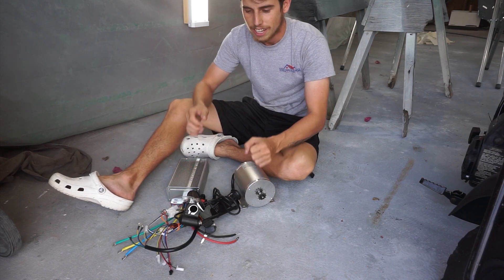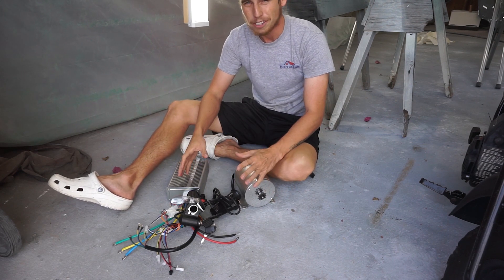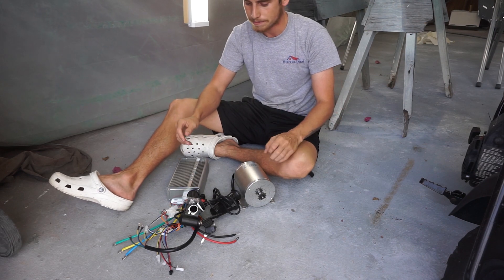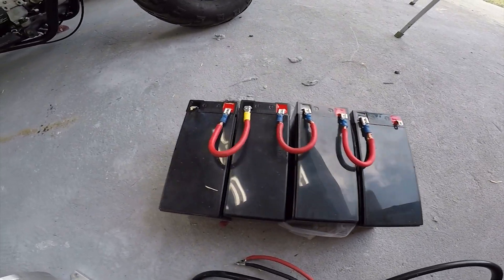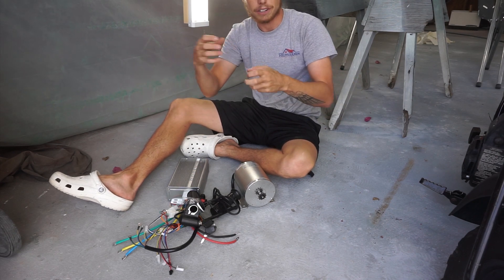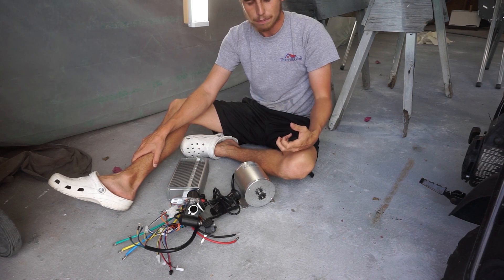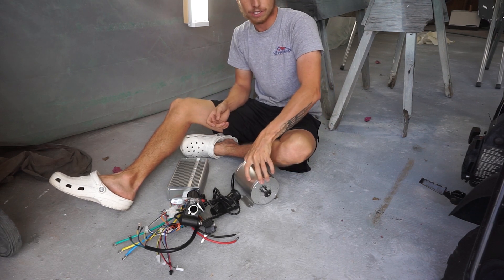As for the batteries, everyone's going to be telling me to get lithium-ion and all this kind of stuff. I thought about doing that, but the packs are so big I don't think I'll have the room for it, and I want it to look all uniform. So I'm just going to go with straight 12-volt lead batteries — the rechargeable kind. That way I can put them in different areas of the bike, maybe balance it more towards the front and have a couple in the back. It hooks up like a golf cart battery — just 48 volts, so four 12-volt batteries.